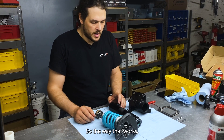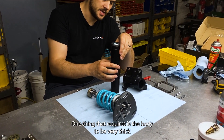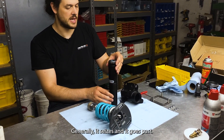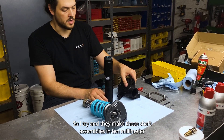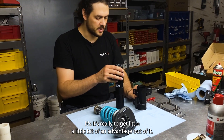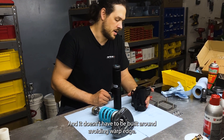The way structural loads work: starting from the outside, you've got a steel tube — pretty typical. Sometimes in the aftermarket you'll see them weld onto the outer tube, which requires the body to be very thick to avoid distortion of the bore. Since the piston rides up and down, if you distort the bore it'll lock up or not function as it should — generally it seizes as it goes past. So you have to have a really thick body, which also limits how much you can weld on it. Nitron makes these shaft assemblies in 10mm increments from short to long with all kinds of different threading — it's not really to save money, it's to get an advantage. You can essentially gusset and weld on an outer sleeve that only needs to be as thick as it needs to be structurally, without having to be built around avoiding warpage.